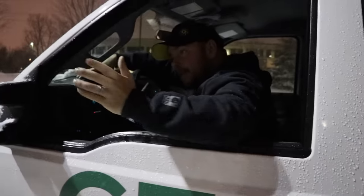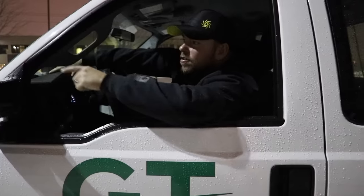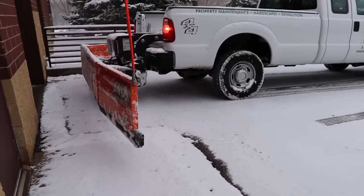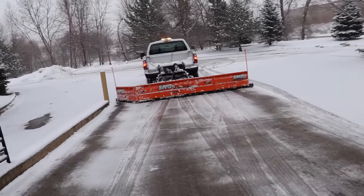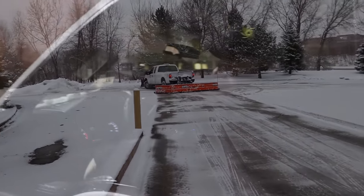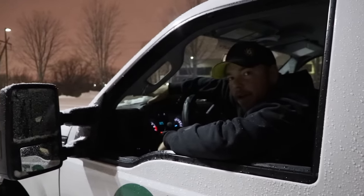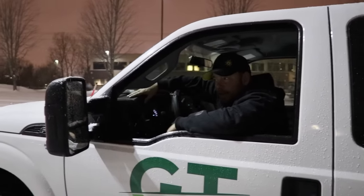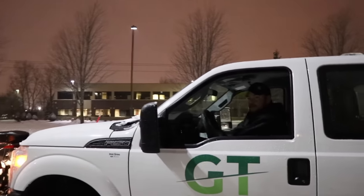Get a nice path through the middle and then bite it off in sections. I was trying to take the full width of the plow, just to be able to back up to that island and pull it this way — which is pretty slick, because once you back-drag with a front plow it squishes it down and you're wasting your time. You've got to wait for a skid steer for tight areas. With this you can just back right up to a curb and pull it right out. I almost didn't even bring the front plow — save on cutting edges. All right, we've got drive lanes to do.